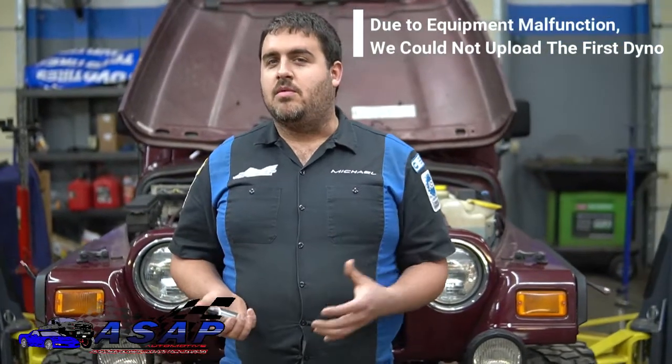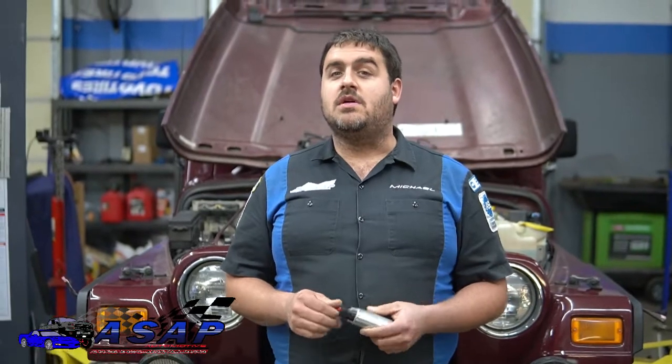So as you guys saw from the other video where we had this thing on the dyno, we quickly realized the problem we kind of knew we already had, but the dyno really told us the truth, is we were running out of fuel really quick. So whenever we did this project, just to keep things going, get everything set up and all that, we did the whole Novak mod kit with the hat for the fuel pump module to bring up the fuel pressure from about 40-45 on up to about 60 psi where this LS engine needs. So that's all fine and dandy.